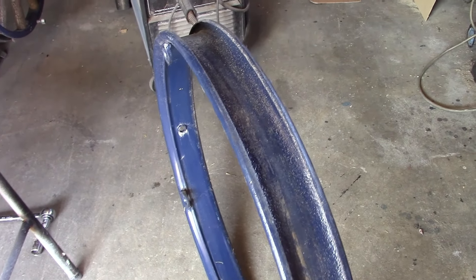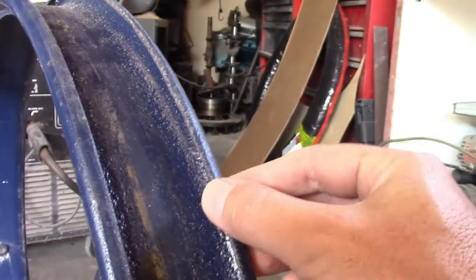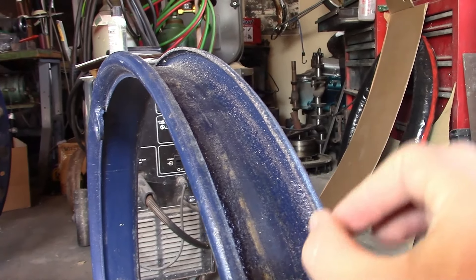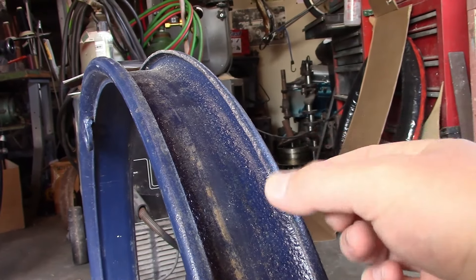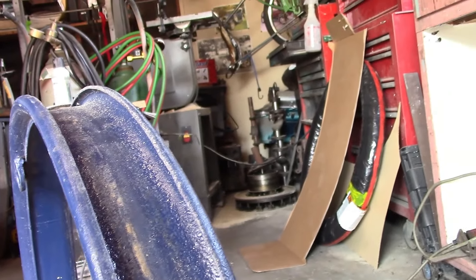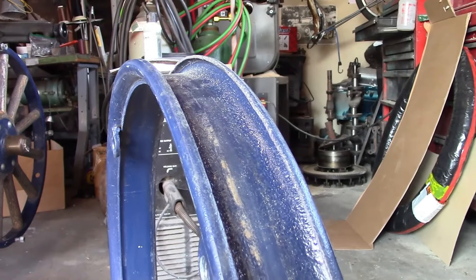The bead getting ripped off the sidewall is a fairly common problem with clincher tires, and is usually the cause of the rim being out of shape. This part is what bites into the bead of the tire, which keeps it from falling off. Now when everything is to factory specifications it works just fine, but these can get rust-pitted, they can get worn down from people driving with no tires, and they can get sharp and then bite through the tire and rip the bead off. Another thing is these can erode away, and the lip can go back slightly, and then it won't hold the bead and the tire will fall off while you're trying to inflate it. So I examined all four of these and they're actually in pretty good condition. There's a little bit of rust-pitting on them, but that's totally fine. So why did that tire fail? It probably did that on a different rim, and the previous owner just got those for free and threw them on here just to roll the car around. But these rims are good to go, so we can just keep working on it.